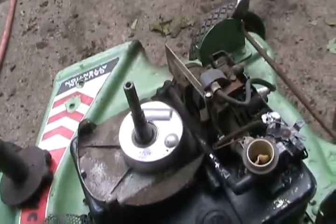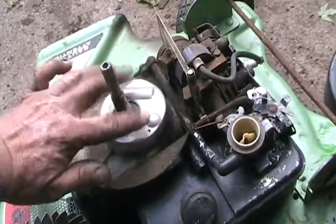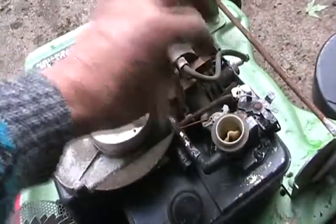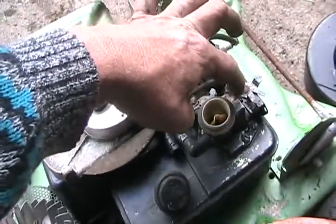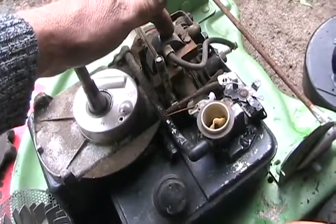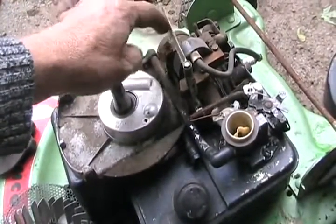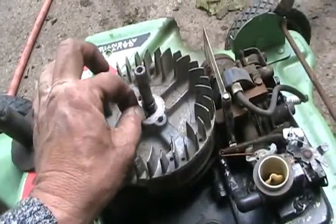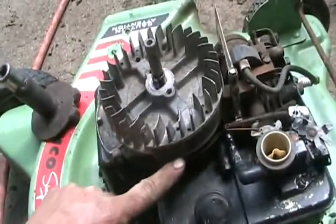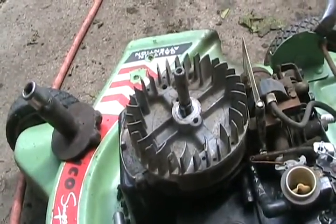Now if you have lawnmowers for parts from more modern units from 1982 and newer — this being a '79 unfortunately — you may have some spare leftover Magnetron magnetos, the electronic ones. They don't use anything under the flywheel; all they have is one wire that goes to the kill switch. So if you want to use one of those, just snip off the wires that go here, hook up the one wire that went to the kill switch to your more modern magneto, and you've converted your lawnmower to electronic ignition without ever having to take off the flywheel — just by changing two screws. Set your magneto as close as you can to the flywheel without touching and that's the correct distance. Some people sand the magnets because they're all rusty — it doesn't make any difference how much rust is on those magnets, it functions exactly the same with the same power of spark.